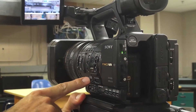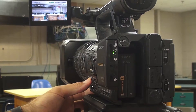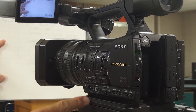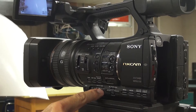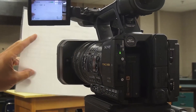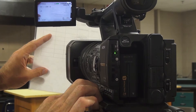The next manual feature is white balance and exposure. There's a little slide on the side that says auto and manual — slide that to the right to set it to manual. Then the smaller ring closer to the camera body controls exposure: turn it to the right and the image gets darker, turn it to the left and it gets brighter. That ring opens and closes the iris on the camera.